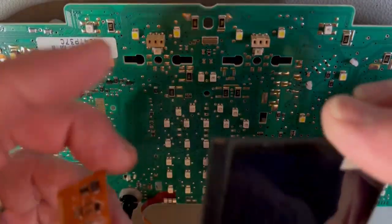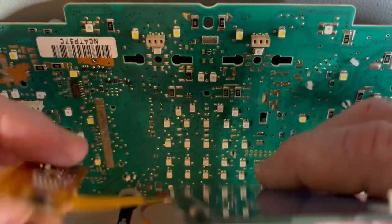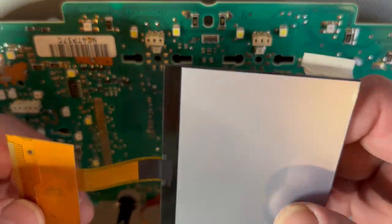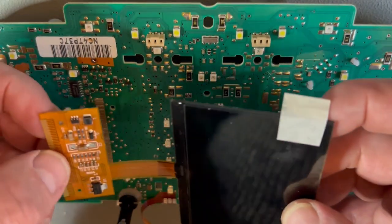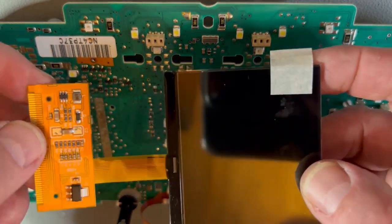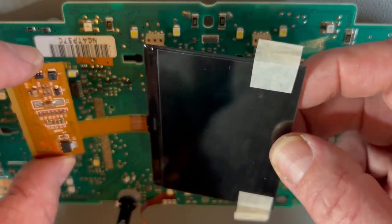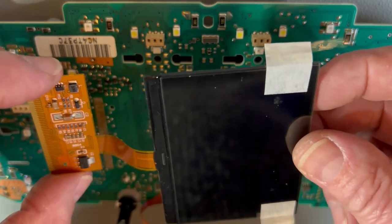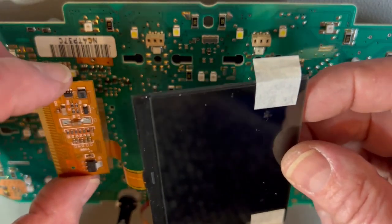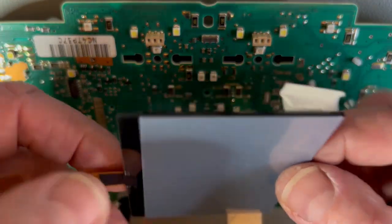Here's the replacement display on the back side — you can see this one has a silver backing. This is one of the better quality aftermarket displays. The original ones fitted to this cluster are no longer available and there's a wide range of quality with these. So if you're going to buy your own replacement, do your homework. Make sure you get one with good contrast — many are just washed out, way too bright when you put them in the car, which is really distracting when driving, particularly at night.